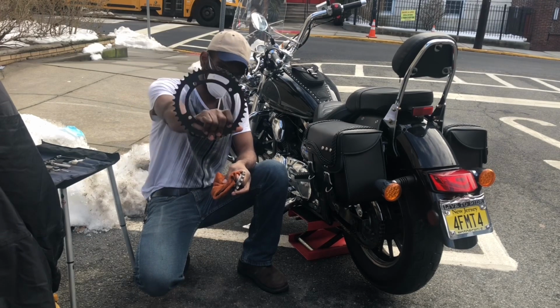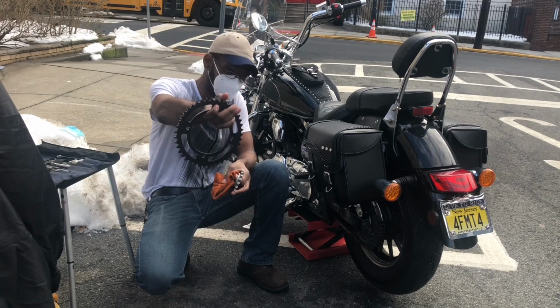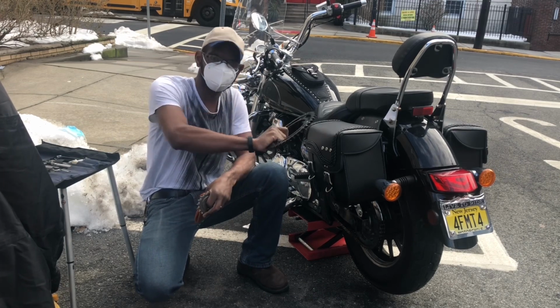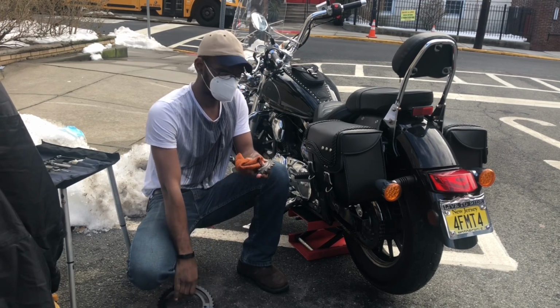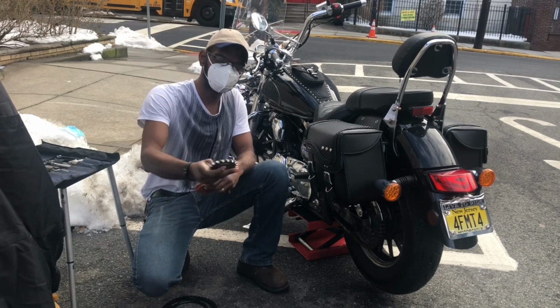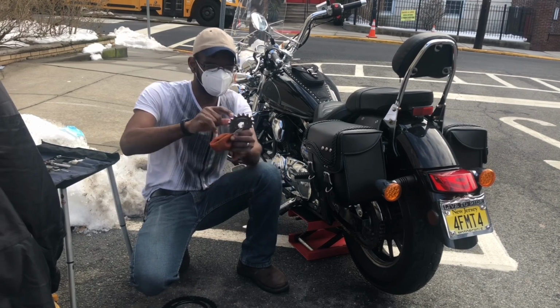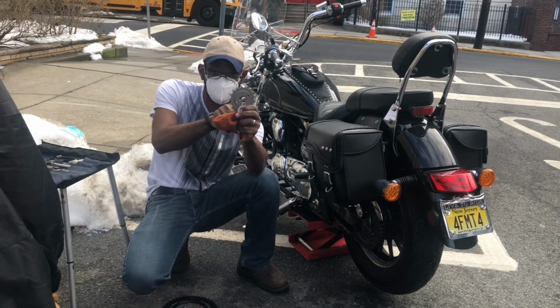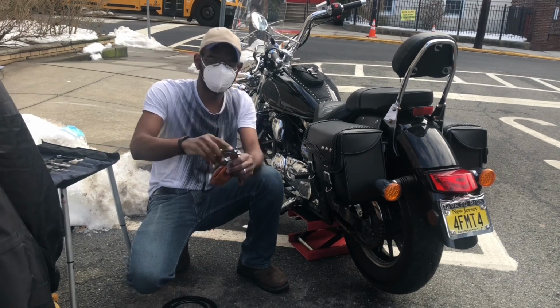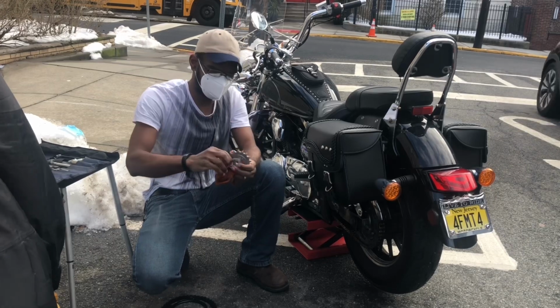rear sprocket, custom modified 42 tooth chain for this bike, which is 530 chain link. And this right here is also a front sprocket, 17 teeth, and that thing right here from here to here is around 25 millimeter. That is specific for this bike.